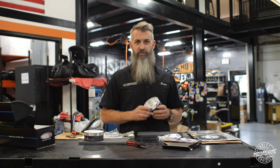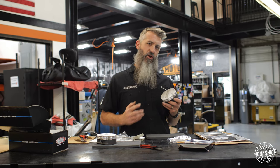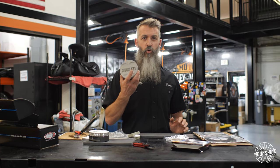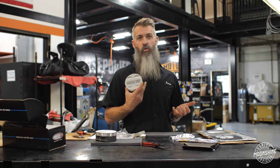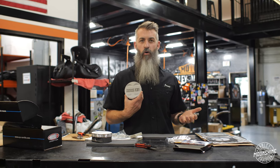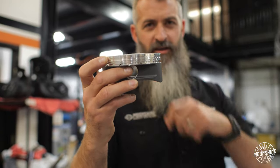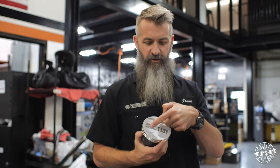One of the reasons you don't see all of our piston cylinder kits all over our site is because we want to have a conversation with you about your compression ratio, your setup, and make sure this is the right piston — or whether you need to go to one of our other setups. This piston right here is for a 34 close, set up for a 592 fueling cam. We also make one for a full race setup — the MHP 588 or a Warp 550. This one is a negative 0.5 cc; you can see it has a dome, a real little bitty dome, and that's because the dome offsets the relief in the piston.